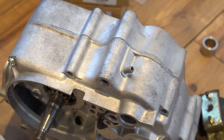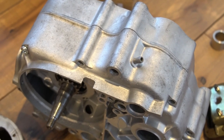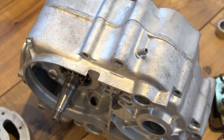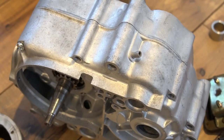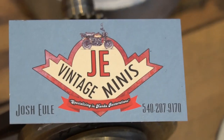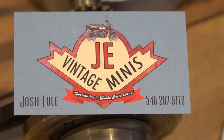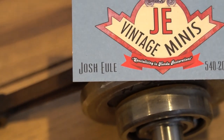Get connected with a local machinist in your market and see if they're willing to do the work for you. A Z50 jug is a 39mm bore, and most machine shops don't have a boring bar or boring head that can fit down into that small a cavity. Try to find someone local. If not, I'd be happy to talk to you about some pricing — give me a holler and I'll get you squared away. I'm in Orlando, Florida. You can always mail the parts to me; it's not very expensive to mail back and forth. I'll do all the ordering and get all the right parts for you. If you want an easy button, give me a call.